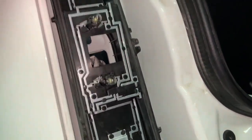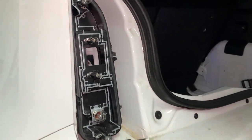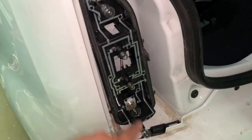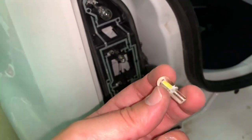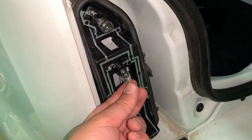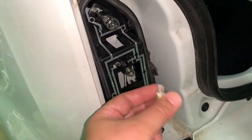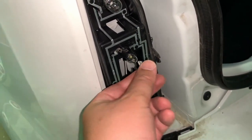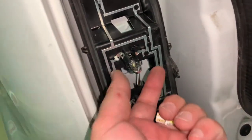I'll change them to LED and show you how they compare with the old halogen. For the replacement of the four bulbs I chose these LEDs — I will put a link in the description. You just need to be cautious about how you put it in: one side will light up the LED, the other side if you turn it in the opposite direction it won't light up, because they need to be in the right polarity. So if you put the LED in and it doesn't light up, just turn it to the other position to check.